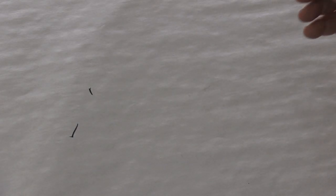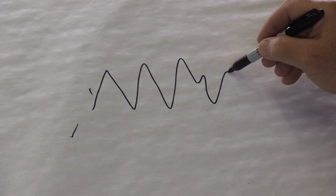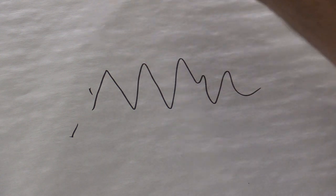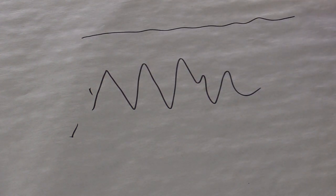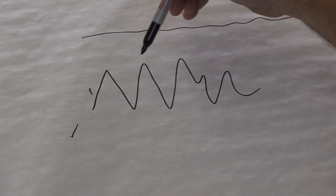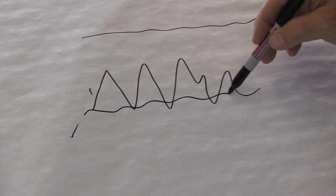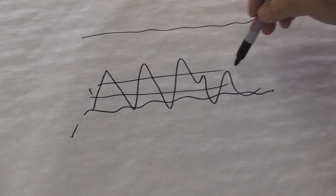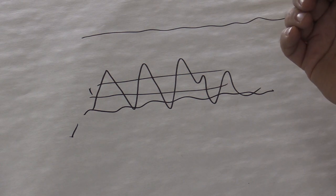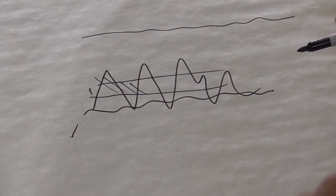What we're doing basically is on the headlight itself — if you figure it looks like this, there are imperfections across the headlight on the flat surface. A brand new one is probably pretty smooth. So what we'll do is take sandpaper, different grits, and cut it down — try to get it as flat as we can. We'll cut chunks of it at a time, going pretty aggressive first. We'll probably do a 220 to start and see what we can cut down. Earlier I did some experimentation on the other headlight and went 80 grit, but it made marks that the finer grits didn't get out.